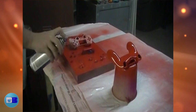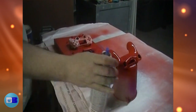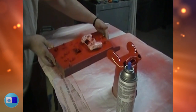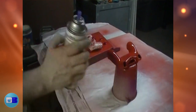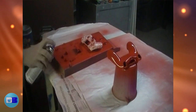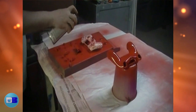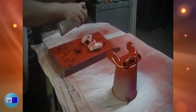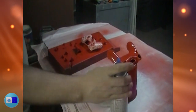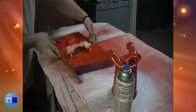And then your third coat, you're going to want to put that one on to where the project looks wet, to where it looks like it does right here now. See how it's kind of glossy and whatnot? That's what it should look like when your third coat is put on. So again, first coat, thin. Second coat, medium. Third coat, medium heavy. And I don't want you to think of it as heavy, because when you think of heavy, you're going to put on too much. You just want it to look wet.